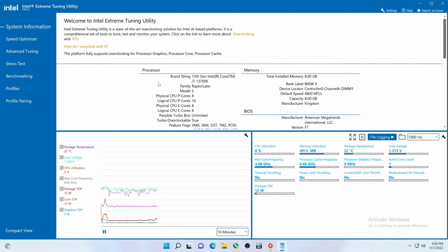So what do we have for CPU cooler, folks? Well, this is the Arctic Liquid Freezer 280mm AIO, and we have Noctua paste on here instead of the, in my opinion, crappy Arctic thermal paste that they give you. I'm not a fan of the one they give you. It's the light blue one that just seems to almost be like super glue at the end with your CPU sticking to your CPU cooler. So we're using Noctua. Temps are lower than they were with the Arctic right off the bat. So this is a good sign.